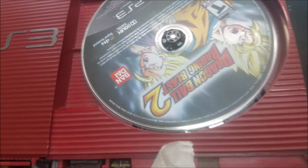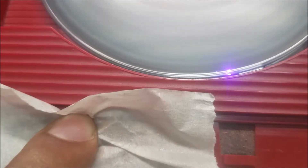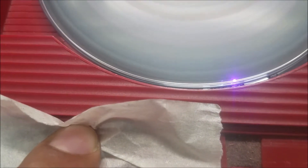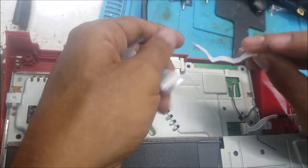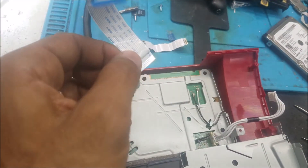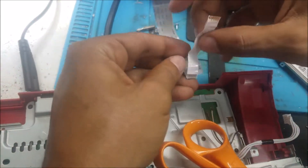After I changed the laser lens, it's stuck over there — it's not moving. The shield moves up and down, but it's not responding. It looks like this cable is damaged because someone tried to fix the disc drive before. I'm just going to use this one instead.